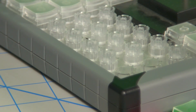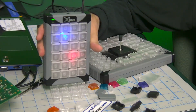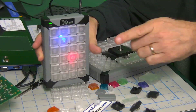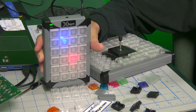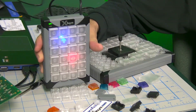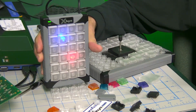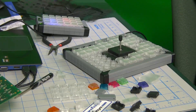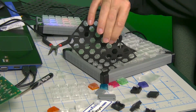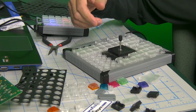While I have this out, I want to show you something else. So in our X-Keys, the backlighting was designed for backlighting, not really key indication. And if you notice here on the blue one especially, we have an issue with what we call bleed over. This is the only key where the LED is on, but you can see that the ones around it kind of have that blue glow — that's the way these things were designed. Now that we have people using these for key indication, like vMix and some other software, one way we can help that bleed over issue is with this mask. You take all the keys off, lay the mask down over the deck, and it helps block the light from bleeding over. It doesn't completely eliminate it, but it does help if you're using it for key indication — makes it easier to see.